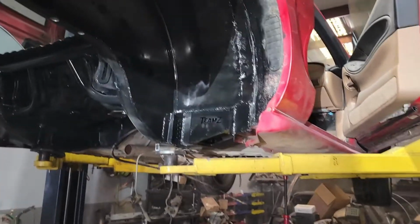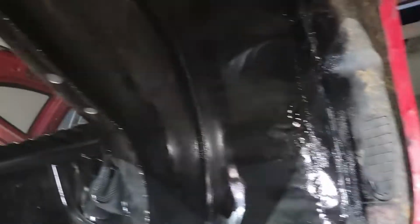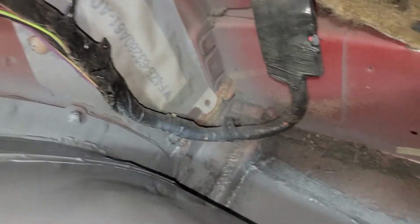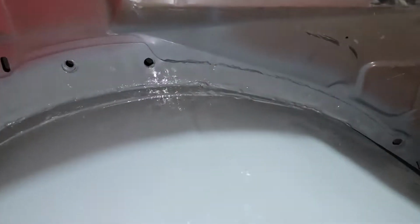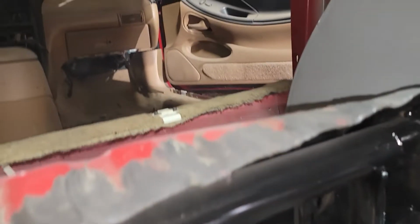Alrighty then, well, it's like 1:30, something like that. I got tubs all welded up, seam sealed everywhere that I can in the edges on the inside and the outside, and then quick coat of paint for now on the outside, black. But all the seam sealer smashed in all the way around. The inside, I did it gray. You can't really see too much of that seam, so that's good.